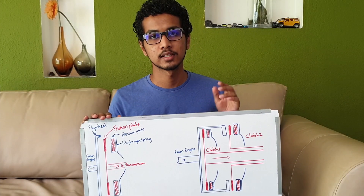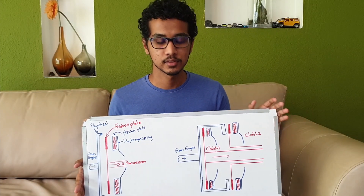To give a simple explanation of how the dual clutch transmission works: if you're in first gear, while you're in first gear, the shifter fork and the sleeve of the second gear would move into place and select the second gear. And when it comes time to shift up from first to second, all that happens is clutch one disengages and clutch two engages — a seamless transition with very little, if any, loss in power.